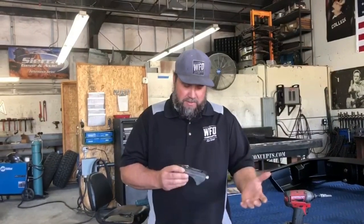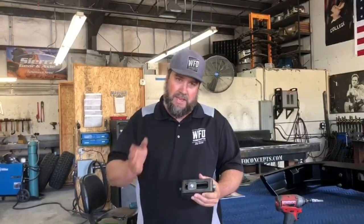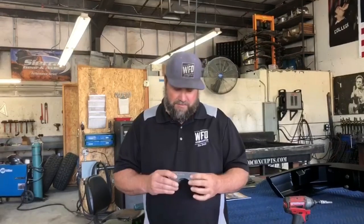The reason this came up today is we're building my cousin's CJ7 and we decided to put these on it because it has a Dana 60 with very tight clearance to the gas tank, and also stock fender wells — so tight clearances to the fenders.